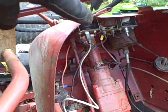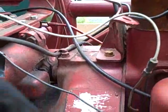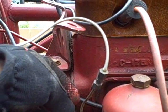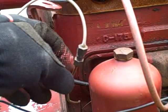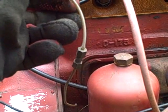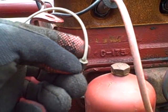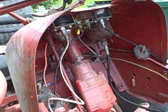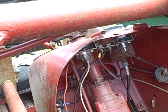The other thing I can do while I've got it shut down is take a look at this oil leak. This is a plastic capillary tube — looks like there's a metal tube down here that comes off the block, and then it looks like maybe it corroded or broke, so they put a little double-female splice in here and put this plastic tube on. It's got a kink right there, which I thought would be where it cracks and leaks, but oddly enough that's not where it's leaking — it's leaking up higher somewhere.